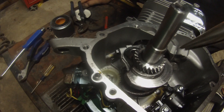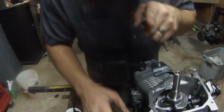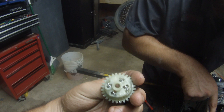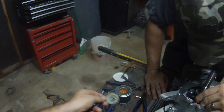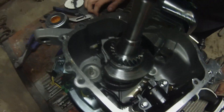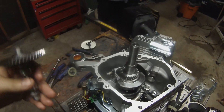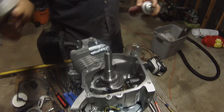Now we can just grab it out of there. That clip right there is the hardest part of this whole job. There's the gear — but there's a tiny washer down in there too. You have to make sure you get that washer out also, or else it will be bouncing around inside. The next biggest thing is you've got to make sure that you put the cam gear back in. We took ours out — take the spark plug out also. You want to make sure that timing mark is lined up with that little purple dot right there. Make sure you clean it really well before you put all this back together.